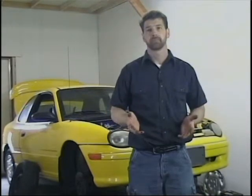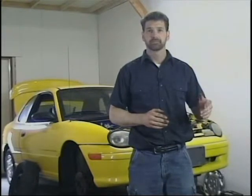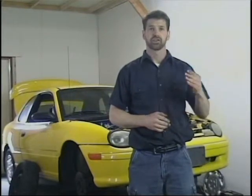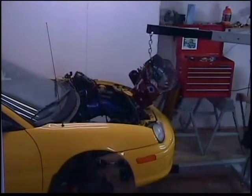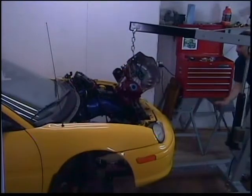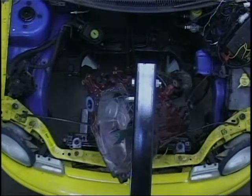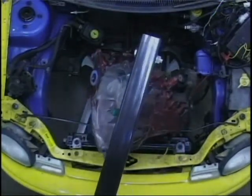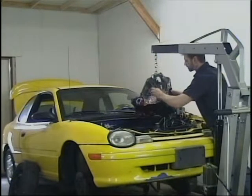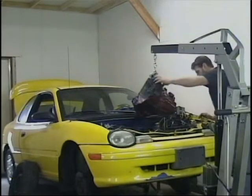I will put the new transmission in, get it bolted up, get the axles ready, and hopefully by the time I am done with that, I will have a new adapter plate to match the transmission and the new engine. One important step will be to switch from gas to diesel in the fuel tank. The fuel will be drained and recycled, and biodiesel or diesel will be added. This car does not have a fuel return and the diesel engine requires one. I have determined to use the existing fuel pump and regulate the pressure, since this car supplies up to 10 times the needed fuel pressure, so I will add a pressure regulator.